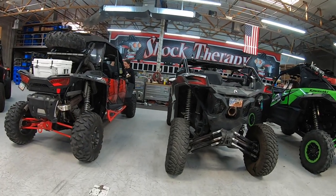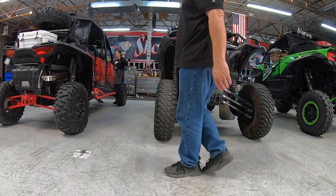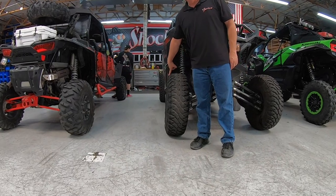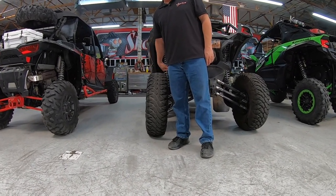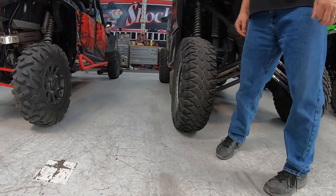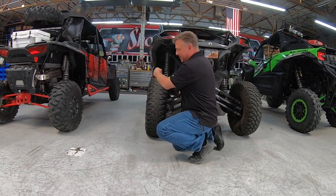You can see if it's off a little bit, and that's about as much as you're gonna be able to adjust, even at an alignment shop. So once you put a set of radius rods on the back of that car, and you look at this one where it's negative cambered, hopefully you guys can tell, by looking through that camera, it might not translate, that the top of this tire is inboard. That would be negative camber. And then what we want you to do is adjust that out until this angle matches the front.